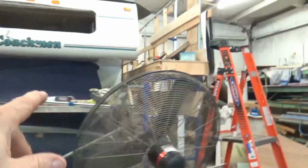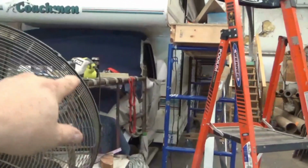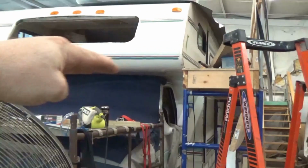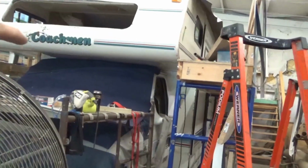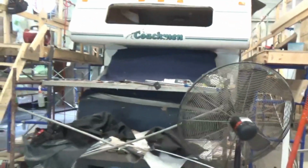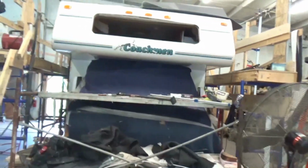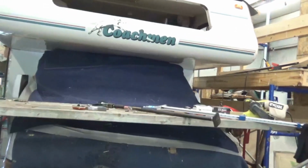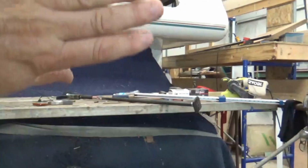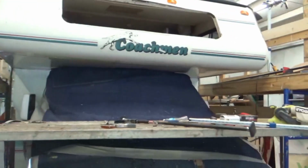And it must be this slide out really pulling on this suspension. Because when I measured everything else, we took it off actually the mirrors. We took it off of body lines to see if it was true. And the camper and the part that we built, the bunk, is all where it should be. But it's just the camper itself has a lean to the left. That's a little over an inch, about an inch and a quarter. So it kind of threw us off a bit to double take and triple take with some measurements to make sure that we're not making it go off. Because sometimes when these come apart, they'll want to sag and settle, and you got to bring them back where they're supposed to be, so you don't end up with issues like that. So, but anyhow, that's what that is.